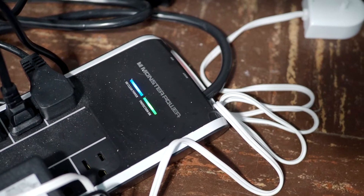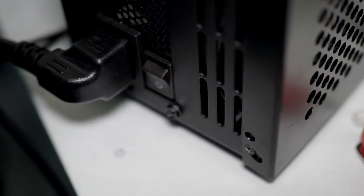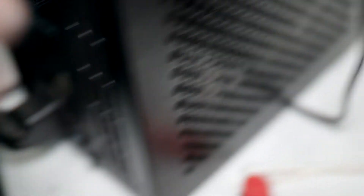So if your computer won't start, start from the first step: checking to see that you have power to your power bar. Make sure your breaker's on, and then follow up. If everything's good so far, how about your power supply? Turn it to the on position, and if that power button still doesn't start, we've got to go inside the case.